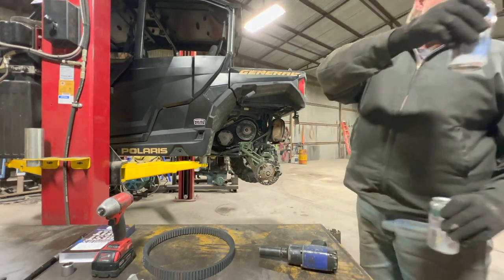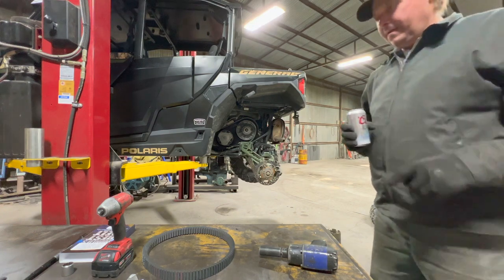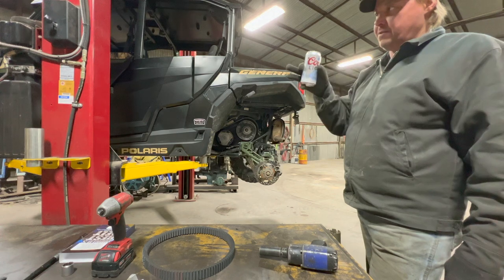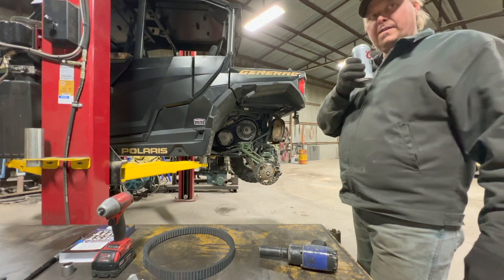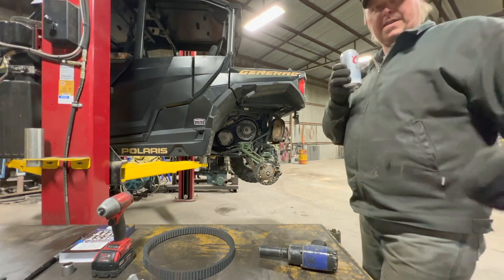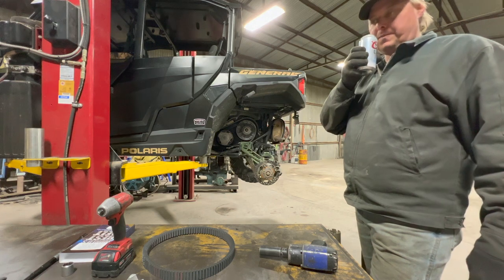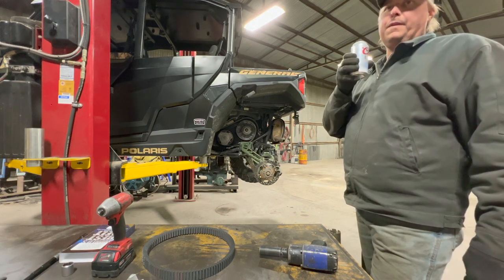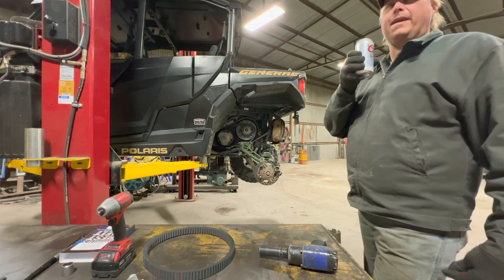It's a replacement for a motor I got out there that's got a twisted crank and a bad block. I just haven't had time to assemble it. That one right there — that's the one we blew up. It's actually a good motor, it just has a wrist pin issue where the wrist pin pulled out of the piston. But at 1.425 million miles, I can't complain.